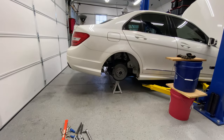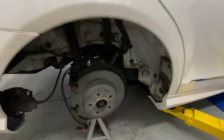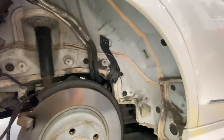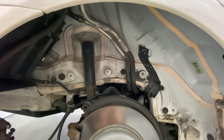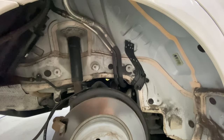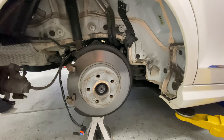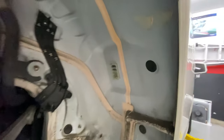I've already started the car but I'm at a point where if I start video recording from here we can get everybody caught up. I got the wheels off - pretty simple, 17 millimeter socket to pop the wheels off. I got the inner fender liner out. It was just a series of little 10 millimeter plastic nuts that hold it on, then there were a couple of plastic pop rivets.